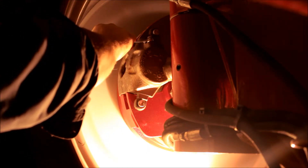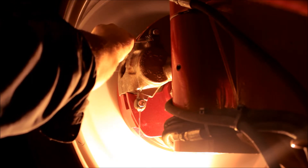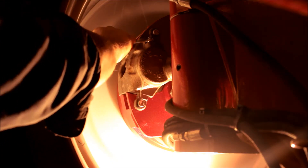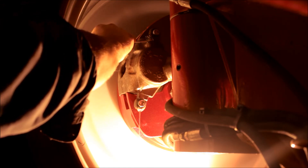Once the pressure is down, release the brakes. Apply the brakes again and measure displacement. The final displacement must be one inch further than the initial one. Keep applying brakes and removing oil from the calipers until the displacement is one inch more than the initial one measured.